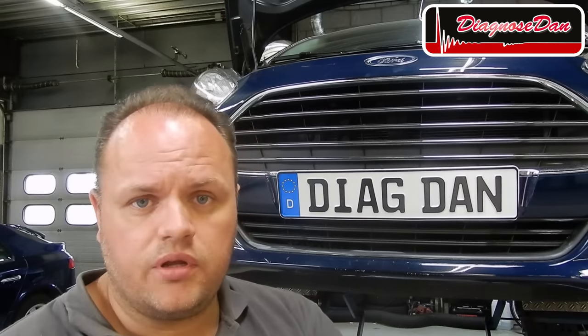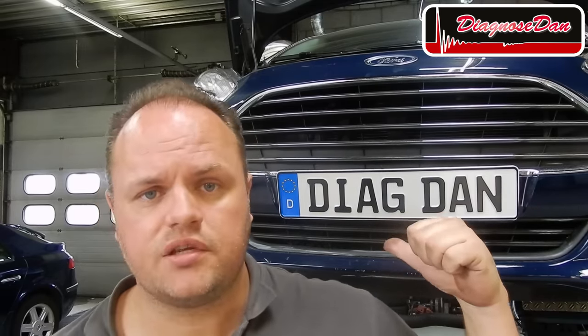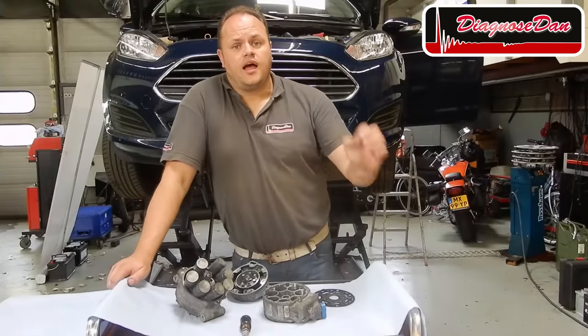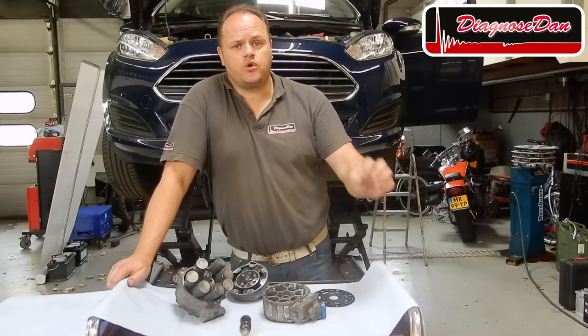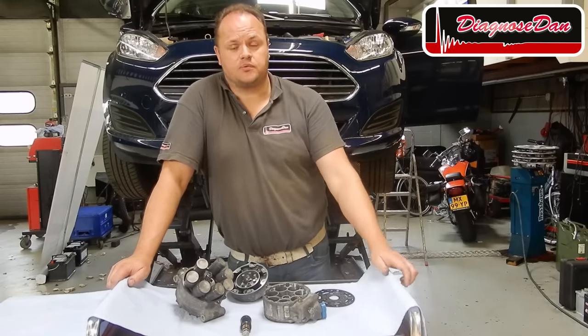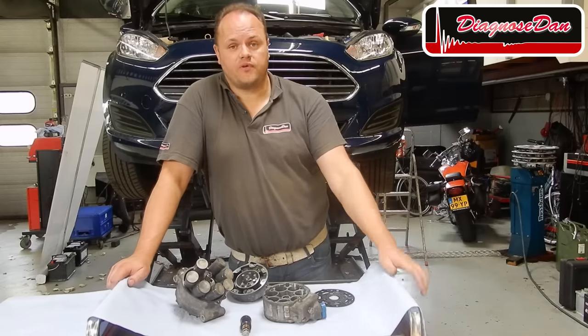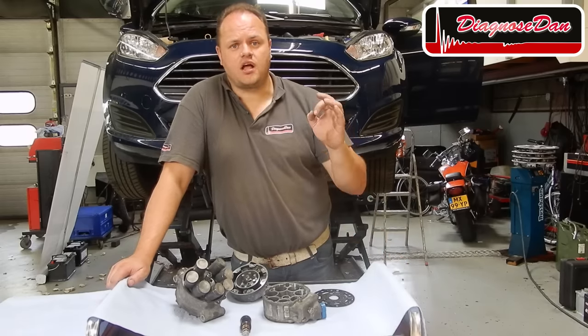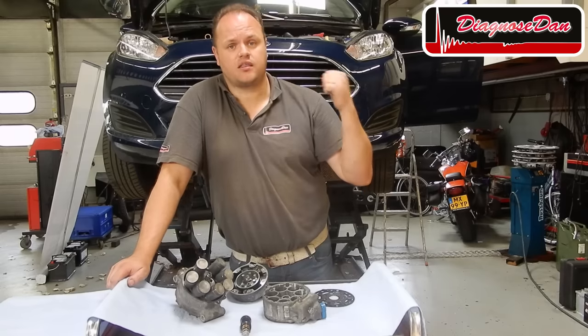Now so far we have learned that our compressor clutch engages and our cooling fan turns on. We also know we've got this variable AC circuit control fault, but what is a variable AC and how is it controlled? I know that most of my viewers have got a pretty good basic understanding of an AC system. If you don't, or if you want to be refreshed, I might do a separate video on the basic operations of an AC system. For this video, let's concentrate on what we need to know to diagnose this car.